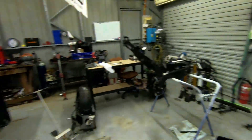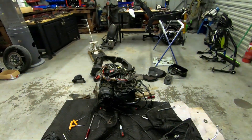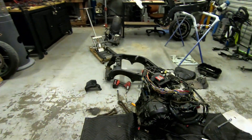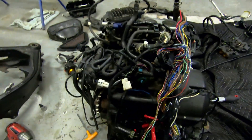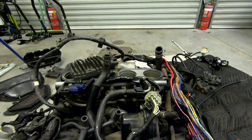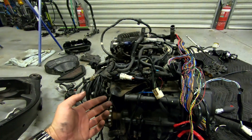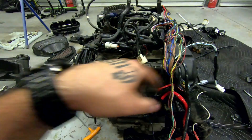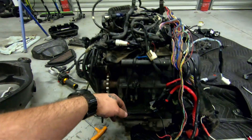I've got the full engine gasket set in — still waiting on the head gasket but that's fine. Now, how do I get this thing onto an engine stand? I need to work on the head, and the rear section is clutch and transmission. I can just drop this loom off. If I use the two rear engine mounts and get some 90-degree angle brackets in mild steel, with four mounting points and a flat plate for the engine stand, I can get some holes going and that should work easy.